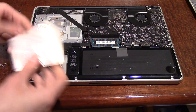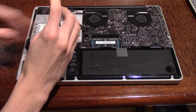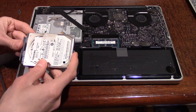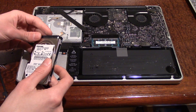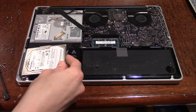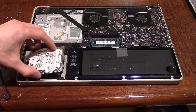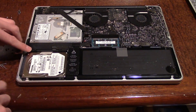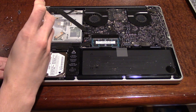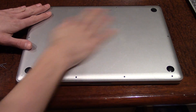Take the cover off the mid-2011 — the hard drive bay is down here. We need to remove the bracket, then plug in our hard drive just like that. This is a 160GB Toshiba drive — it's an Apple-branded drive. For those people concerned I'm not using genuine Apple hardware — obviously I'm just joking, because who cares. Apple charges way too much for their upgrades anyway, especially now that RAM is soldered to the motherboard on some machines.